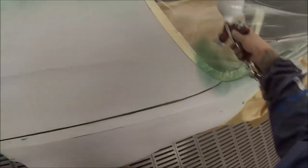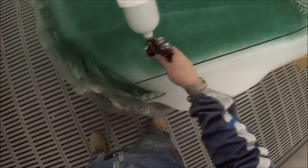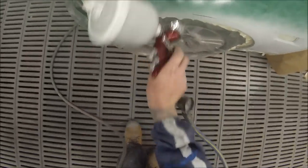If I was painting the car black, I obviously wouldn't worry about a ground coat because you'd get coverage after two coats anyway. I ended up putting five coats of colour all up — two coats of this ground coat and three coats of top coat.